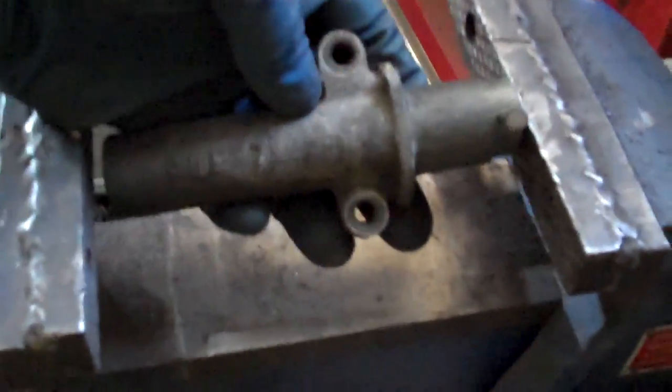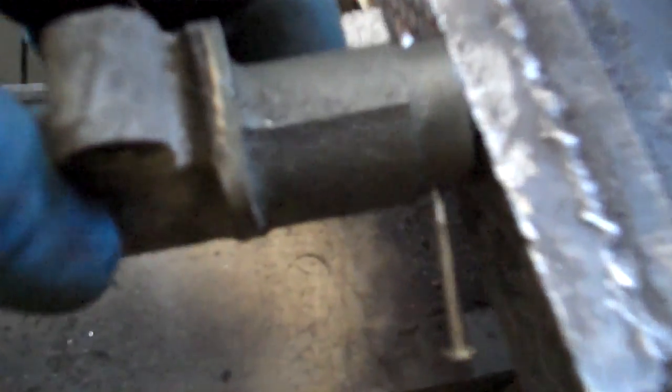Oh, wait, a side note, how you do the tensioner on these. I like to call them a grenade tensioner. You can press them, you get all this pressure build up, and you put a pin in it. You install it in the car, and then it goes off.